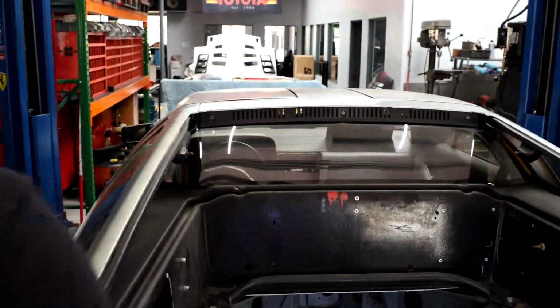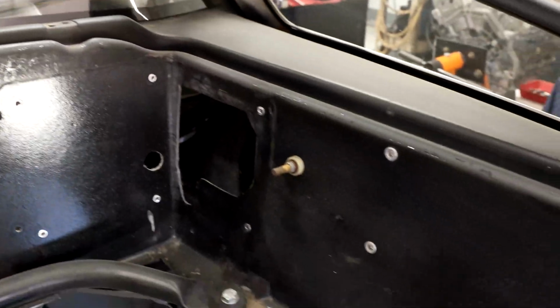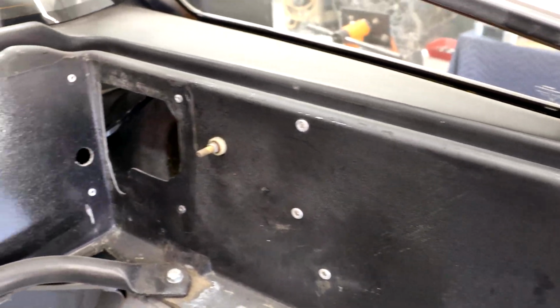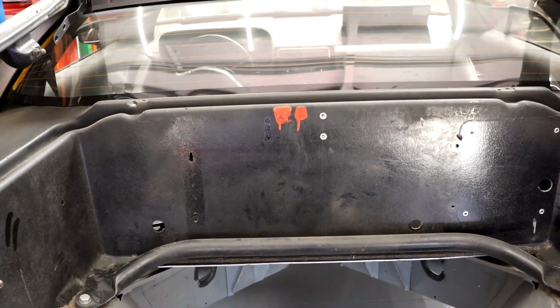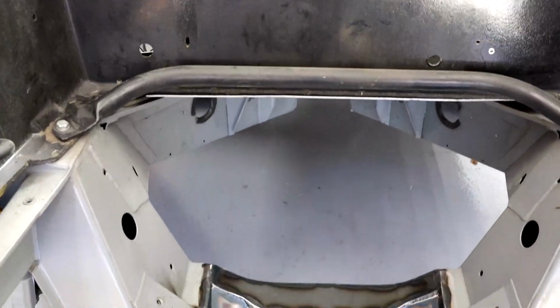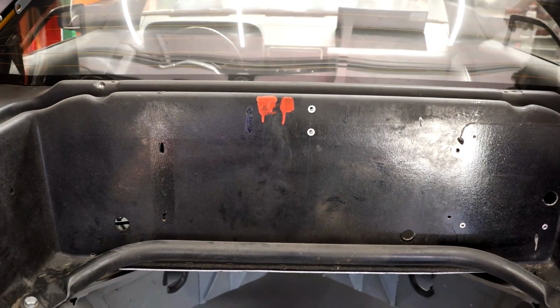So now that we've got the suspension mostly dialed in and we've got the fenders rolled, we're going to be moving to the back of the car, and Martin is going to be doing the work that he has to do on the fiberglass tub of the car. So if you guys remember, this entire fiberglass tub got modified a bit. So we filled in this hole here, and same on this one, and we made this hole here for the surge tank, as well as patched some of these other holes that we're not going to be using. One of the best parts about doing this car the second time versus the first is we know where everything is going to go. So even before we put the engine in, Martin can do all the work to the fiberglass tub and have that ready to go, and just put the engine in the one time and be happy and satisfied with the placement.